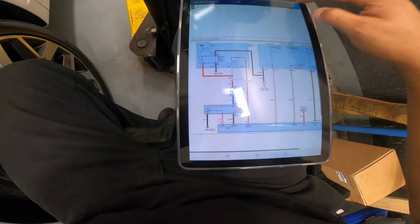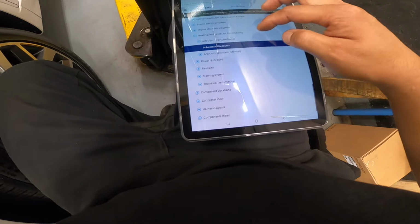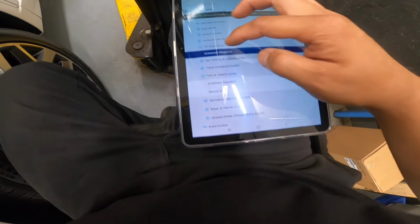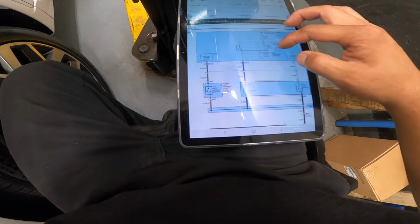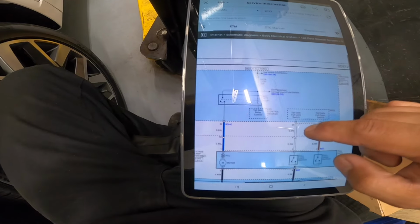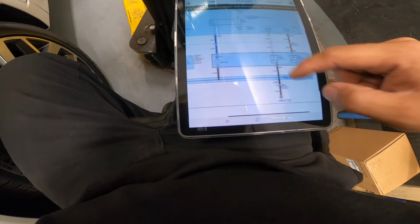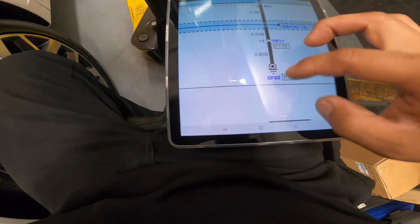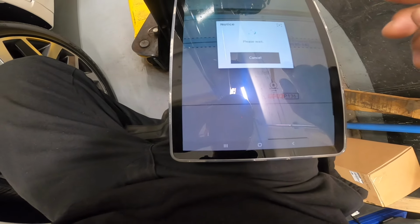And then that's so weird for the tailgate to open by itself. I haven't seen that before. So let's just go to our tailgate opener. Let's just see that circuit quick. So we got a door lock, 20 amp there, okay. What else? Tailgate latch, GF03. With GF03, that's the same as our ground on our turn signal.